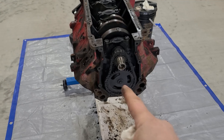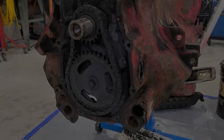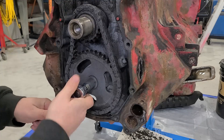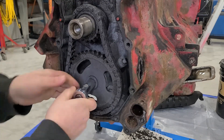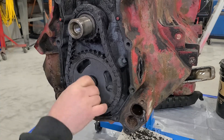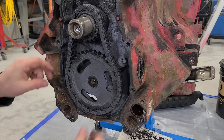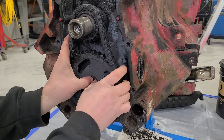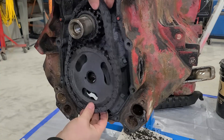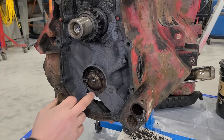I just need to get the center bolt out of the main top gear, which is the one attached to the camshaft. The camshaft bolt — you'll need a 5/8 ratchet on that. It's coming off nicely, as is everything. Now we should be able to slide the timing set gear off — yep, just like that. Timing set is off, and there is the end of our camshaft.